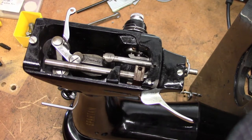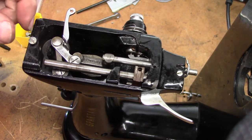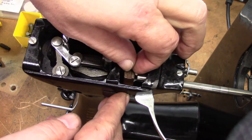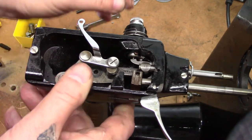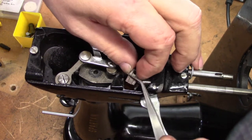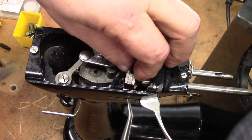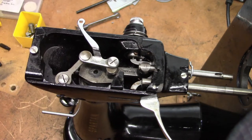I've got the machine sitting on her back with a block of wood under the back near where the motor boss goes. We're going to slide the presser bar all the way down — that cleared the block out a little bit — and get the needle bar all the way down to see if we can lift out the sliding block for the presser bar. It's a little bit of a tight fit, but it's out now.